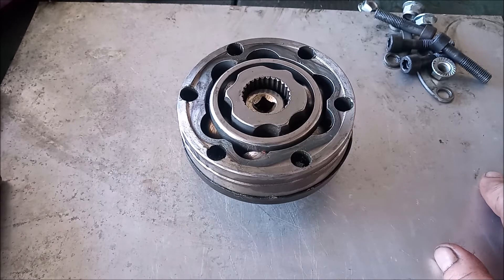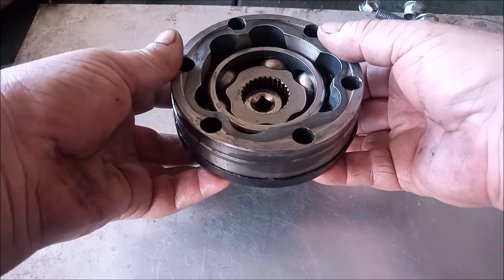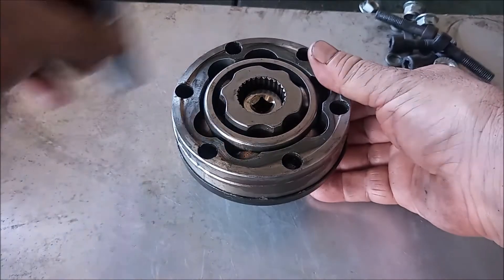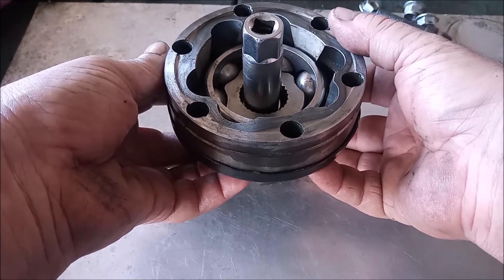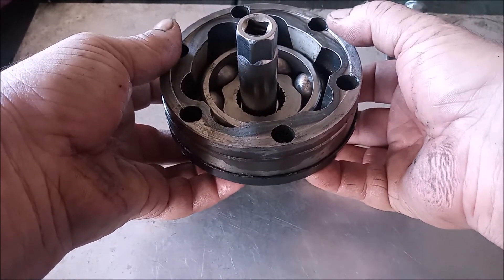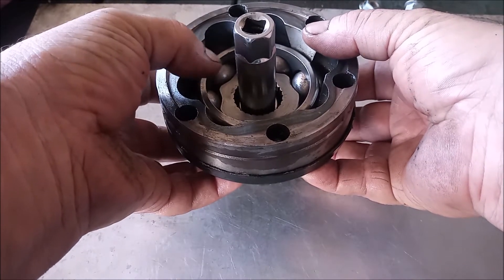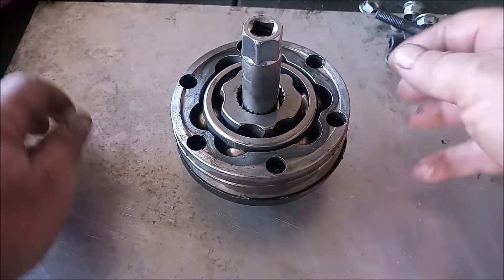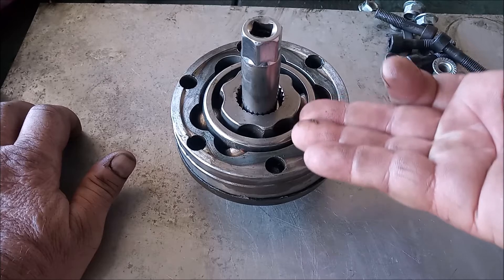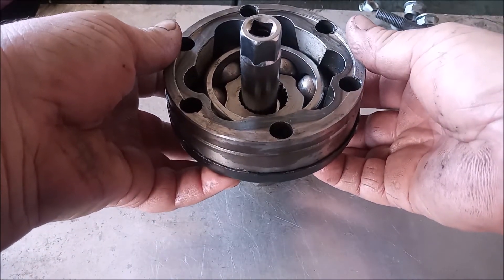To do it, I have followed the method outlined in the Toyota repair manual, the big green book. What they describe is assembling the joint from the top, starting with the inner race supported from underneath, and you lift up and insert the balls one by one. They specifically mention using a spark plug socket, which prevents the balls from falling through the middle of the inner race. When you get the bottom of the outer race exactly aligned with the top of the inner race, the grooves all line up.